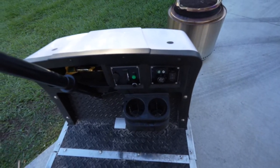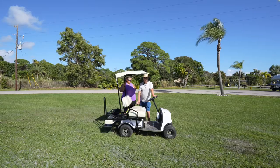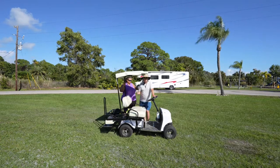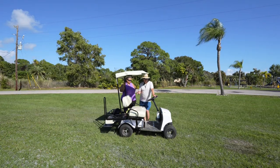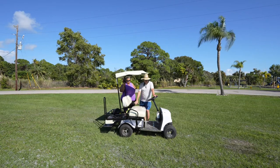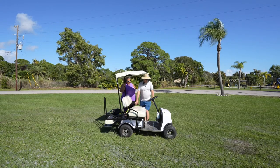One interesting thing: there's only one pedal on this golf cart. The pedal is the gas and the brake at the same time. It works kind of like an exhaust brake on a diesel truck — when you step on the gas, you go forward. And as you take your foot off, not only does it reduce acceleration, it also applies the brakes at the same time. So if you're not used to it, when you take your foot off the gas you just come to a jerky stop. You have to be very light on the pedal so you don't get jerked around.